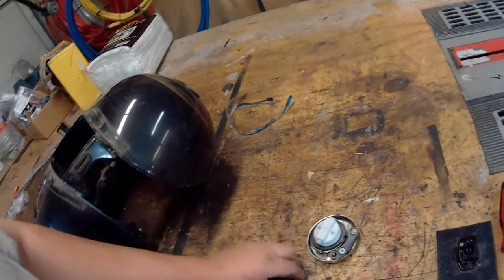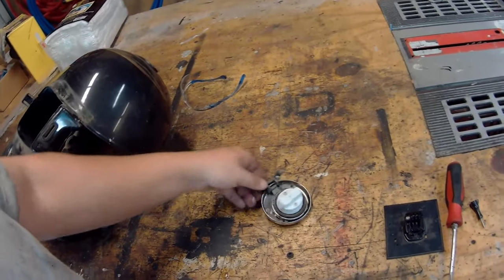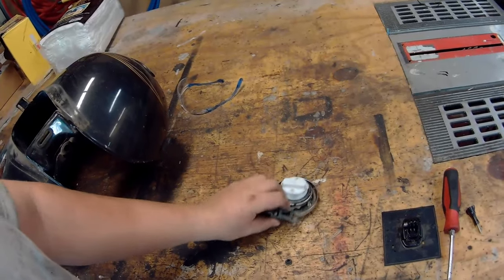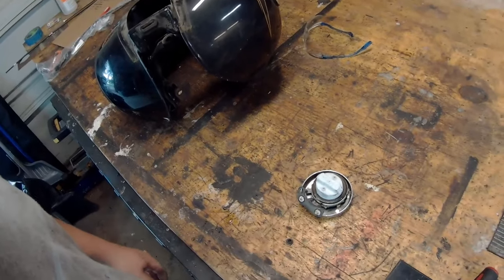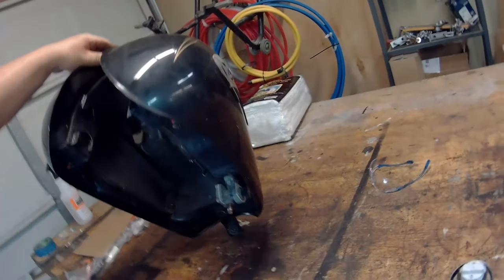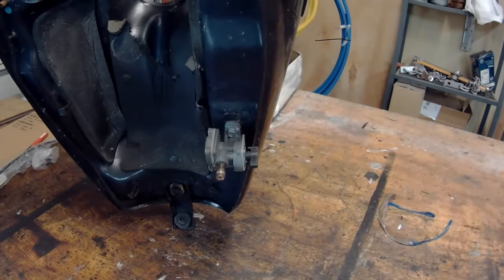In the meantime, we can turn our attention to this tank. This is actually rusted shut or seized shut — I had to use a pry bar along with the key to get this to unlock and open. What we're going to do is put the cap inside. I'm going to see if I can take some of these rubber gaskets off. If not, we'll put it straight into a can of Berryman's Parts Cleaner. With the tank, basically we're going to pull off this petcock assembly — I went ahead and bought a new one. We'll get all the liquid out of there, then we'll seal up the tank and fill it with a special concoction.